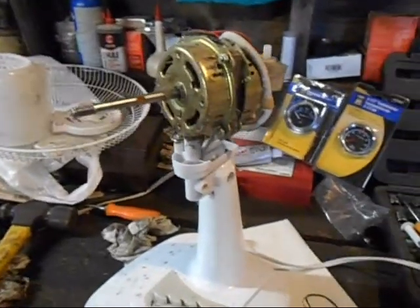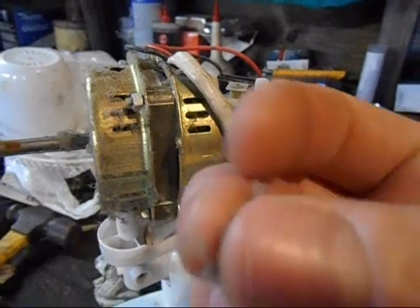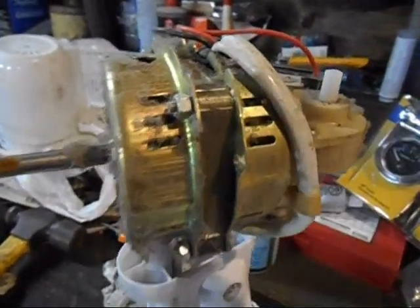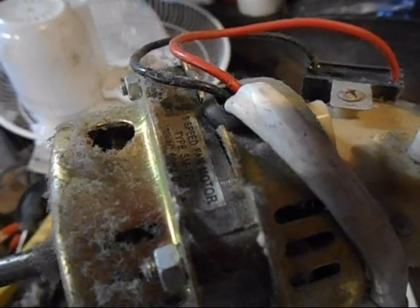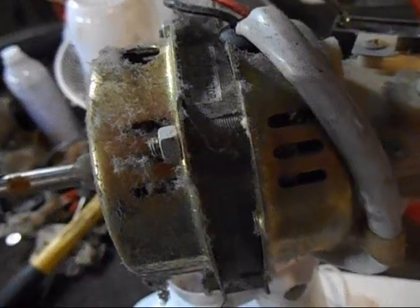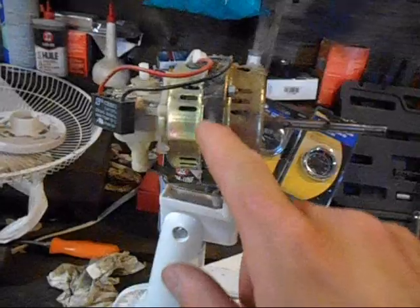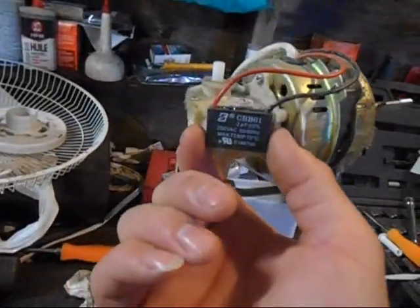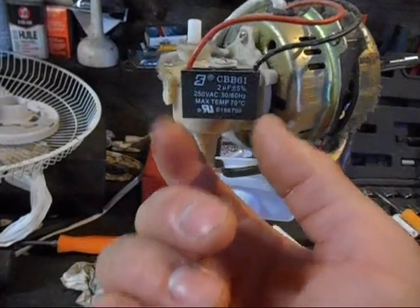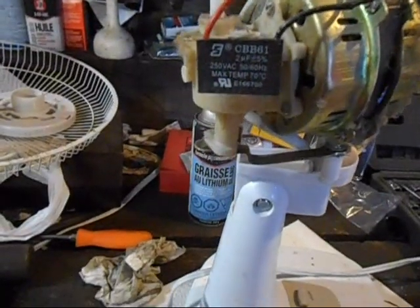Here it is with its clothes taken off. You can see it's caked in dust — and it's kind of greasy too. A little sticker just says three-speed fan motor, Type SM-12, 120 volts AC, 60 Hertz, 0.3 amps. Look at this small stator here, and it's only got a two-microfarad capacitor. Sorry for the wind noise — I have a fan on because it's just cooking out today and I need a fan on me.